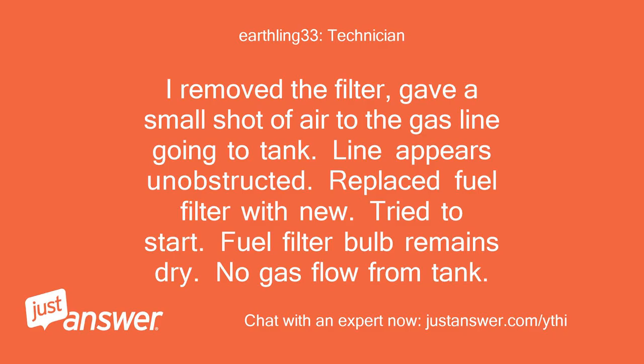I removed the filter, gave a small shot of air to the gas line going to the tank. Line appears unobstructed. Replaced fuel filter with new. Tried to start. Fuel filter bulb remains dry. No gas flow from tank.